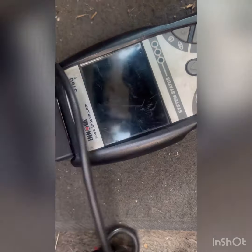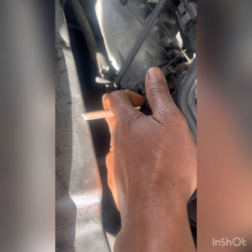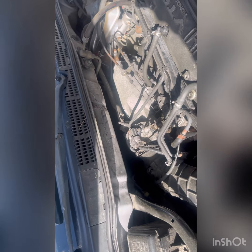The idle air control valve — this is a 2002 reference but it's pretty much the same thing. This body style runs from 1998 to 2002, and it also came with a V6. The idle air control valve is all the way in the back, right there. What we're gonna do is remove this intake tube and all the stuff connected to it, then remove the brake booster hose. After that I'll show you how to get that idle air control valve off easy.